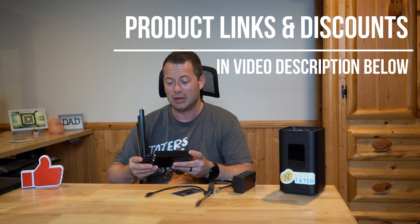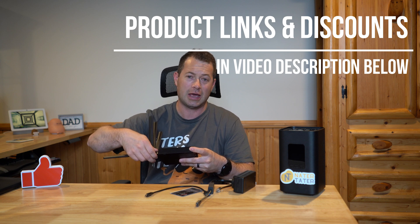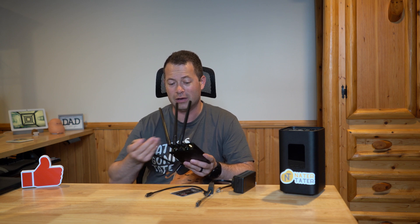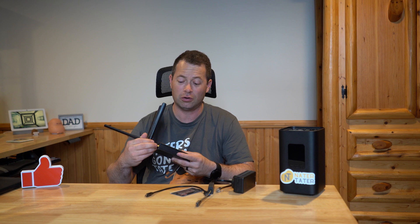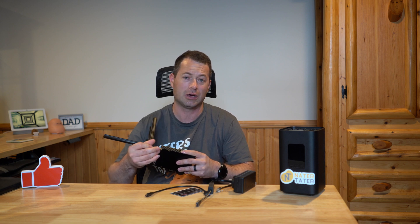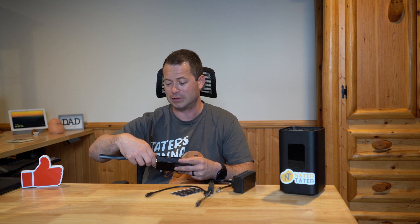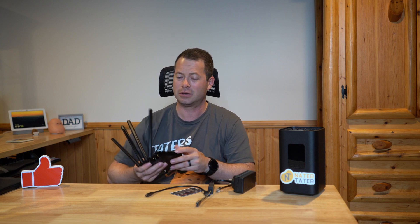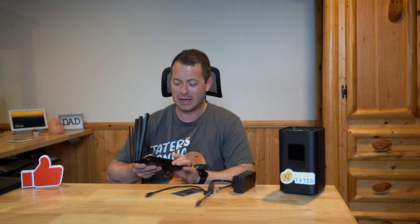To go over what comes in the box: the antennas are not screwed in but are very simple to screw in. It has four antennas — they're all cellular antennas, which is why there are no Wi-Fi antennas, because it doesn't have Wi-Fi. These use a standard SMA connection, so if you already have something like a Waveform antenna installed, you can screw the antennas directly in. That's a nice feature that pretty much all these third-party gateways have.